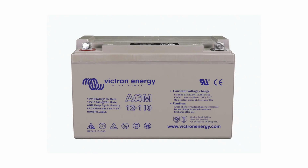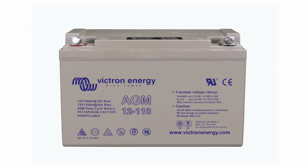Yeah, it did great. Another type of battery that you'll see is called AGM, or absorbed glass mat, or sometimes just called glass mat batteries. And it is a sealed battery, does not require any maintenance, which is good. I've never heard of that before. Yeah, shocker, I know. So those are still going to be heavy, but they're not going to require any maintenance, and they are going to be a little bit more expensive than your flooded cell. So it's kind of one notch up from your flooded cell.